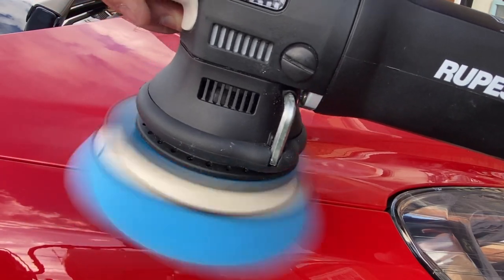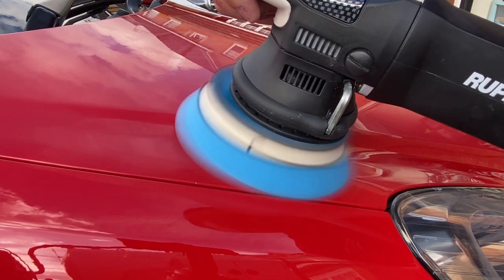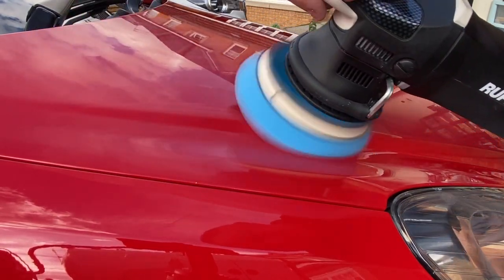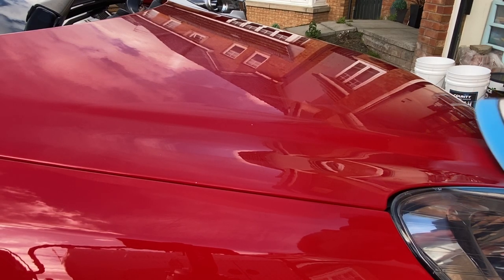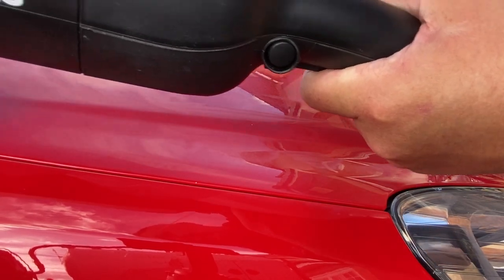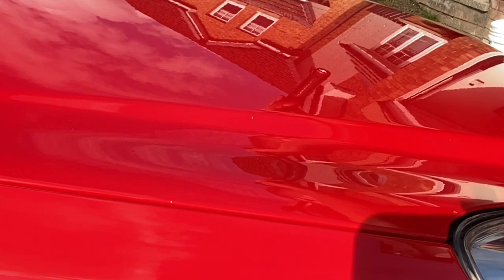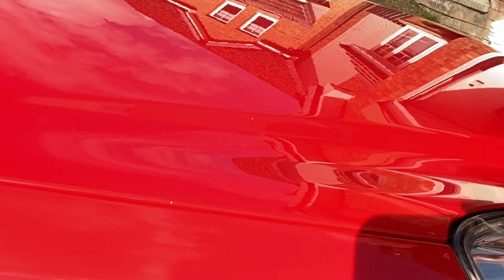The keen-eyed among you will have noticed the polisher stall out along the edges. That's to protect against the pad burning through the edges of the paint - it doesn't know whether you're using a glaze, polish, or wax, so it's designed to stop turning to prevent damage. It still oscillates, which is a scrubbing action, so it's important you're not leaning on the polisher to gain traction. If you can't get the pad turning by a little manipulation, you could do that section by hand or switch to a smaller polisher. A direct LED torch is ideal as an inspection light for checking for swirls or holograms.